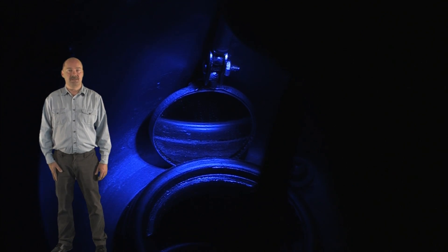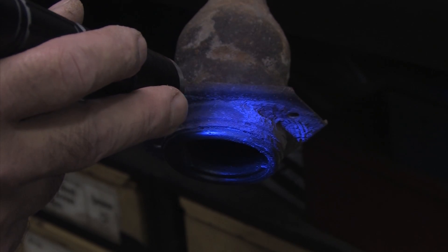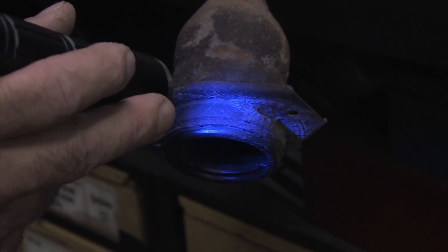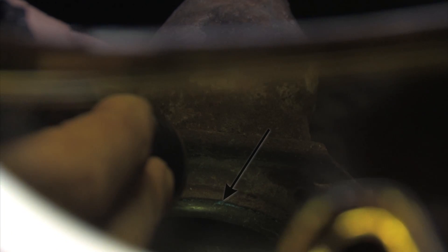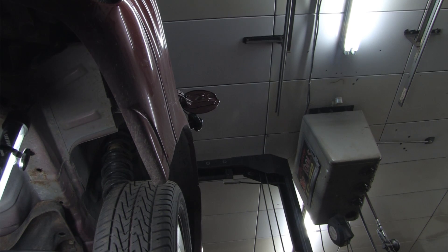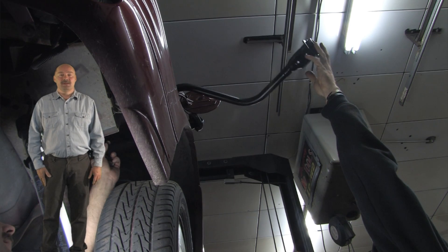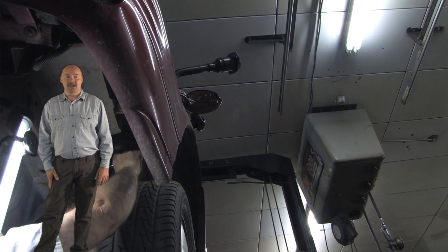When the pipe begins to oxidize around the plastic, a gap between the two is created. Here is another view with the pipe relief — you can clearly see the dye with the tinted glasses held in front of the cap. The filler neck was replaced and the codes were cleared. It has been several months since the repair and the P0440 code has not reset.